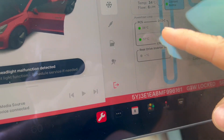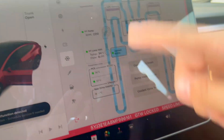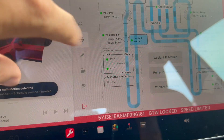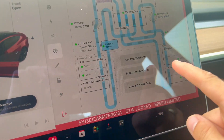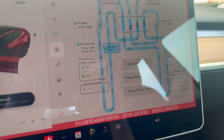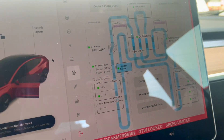Here are the temps — they were at 79 and 85, and one was at 110. Now the fan is kicking on and everything is circulating. All the lines are blue, circulating at six liters per minute. A lot of times it goes up to 18 or 19. Sometimes one section will be purple and the other blue, but if you keep purging it will switch back and forth multiple times before it gets the air out. Now all my battery temperature levels are dropping because the coolant is finally flowing.